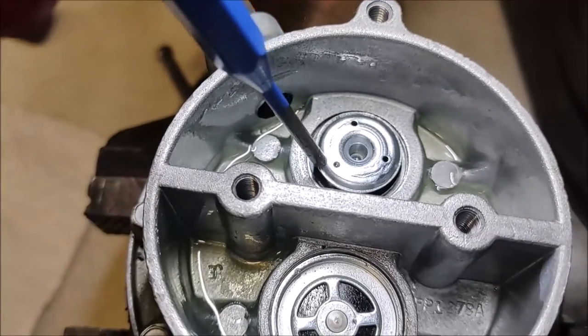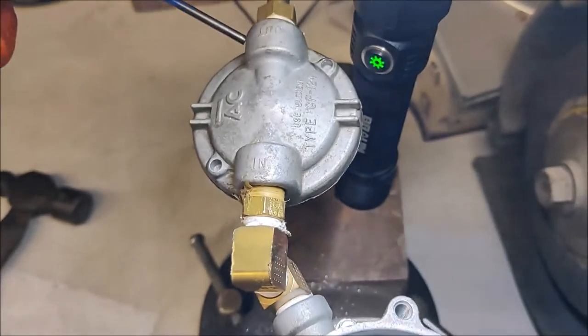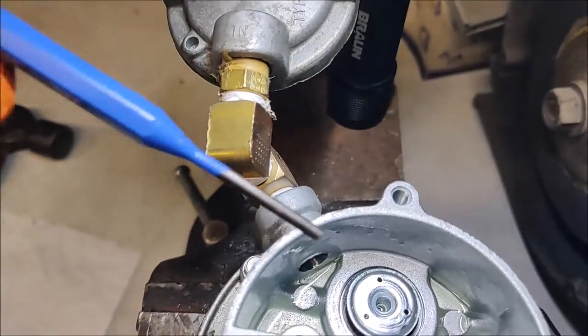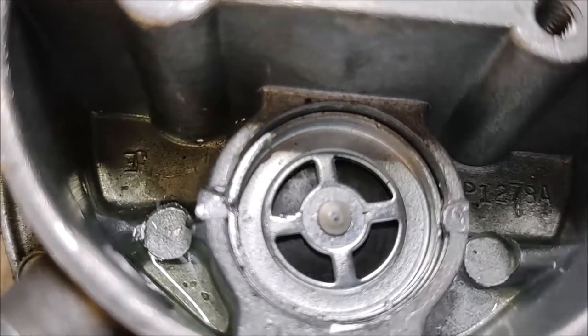The purpose of this valve here is to seal that up so you're not taking gas from the carburetor and pulling it back in. We've now peened this over — the one on the left is not as clean of a peening job as the one on the right.